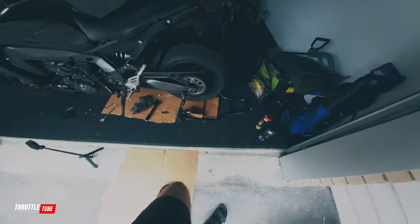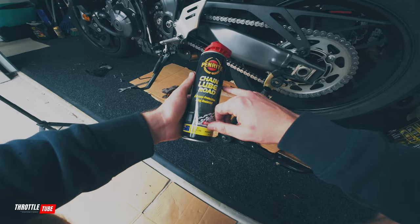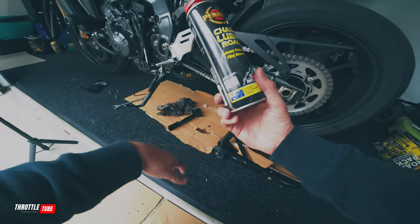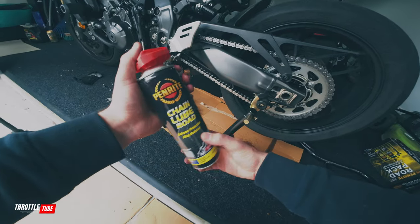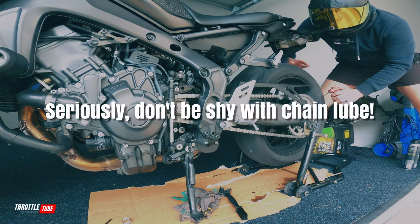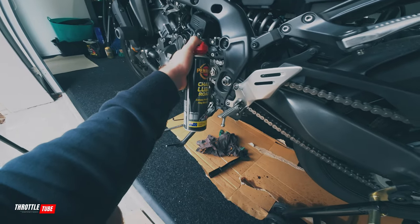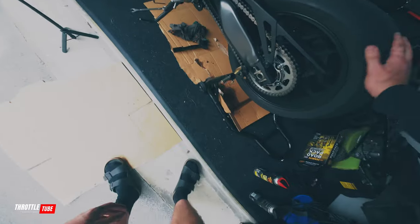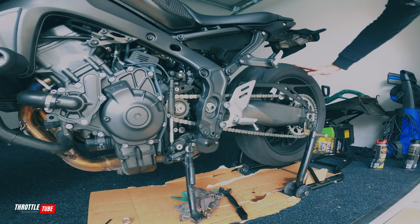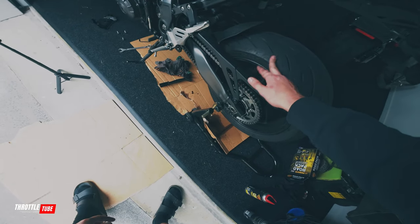So it's been five or ten minutes — we've come back and it looks pretty good. This is where we use the chain lube. You don't have to get this particular brand, it's just motorcycle chain lube — it's obviously designed not to fling when the chain's spinning so fast. Same as before, you just want to get it right in there, and don't be shy with this stuff. Put a tiny bit in the front sprocket for good measure, and that is pretty much that. Make sure you let this sit for a while so it can all soak in. Bear in mind that for a little while it might fling up onto your tire, so when you're doing hard left turns be aware of that to start with.